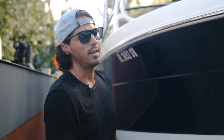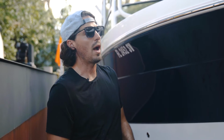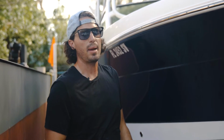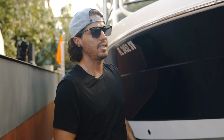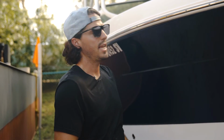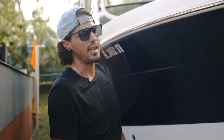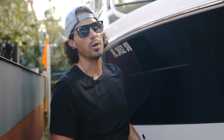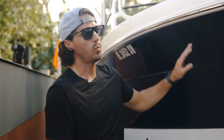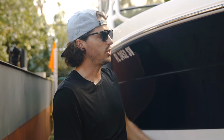All right, so that's a wrap on this 24 Robalo. It is very important to wax a dark colored gel coat hull like this. If your paint, it needs less wax because it stays shiny for so much longer, but gel coat, really, it gets so hot to the touch, and in the sun, especially here in South Florida, will just burn out, and you'll have a faded boat in a matter of a few short years. So it's very important, if you don't have a cover, it's not stored inside, to please wax your boat every 3 months, especially if it's dark colored gel coat hull like this.